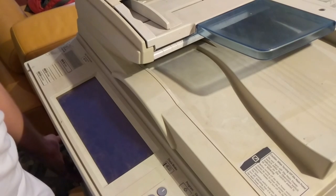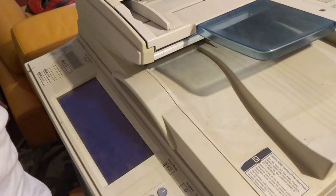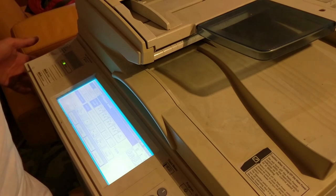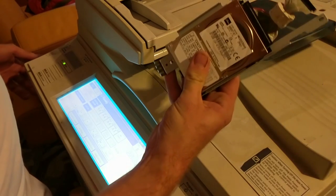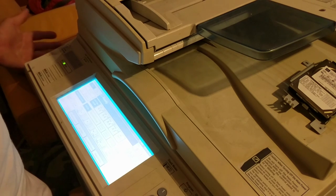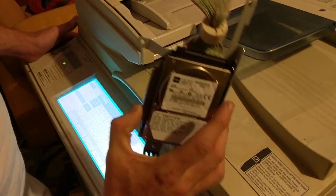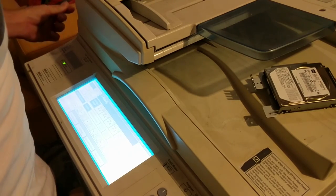Alright, nothing left for it now but to plug it in and switch it on. Wish me luck. Holy crap — it actually worked! Yank the broken hard drive and the thing powers right up. This is actually hilarious because earlier today I actually tried switching off the hard drive in software — no dice, still flipped out every time — but now the thing's actually ready to go. Holy crap. So long story short: if it doesn't work, pull the hard drive — you are back in business. You have a photocopier again, huzzah!